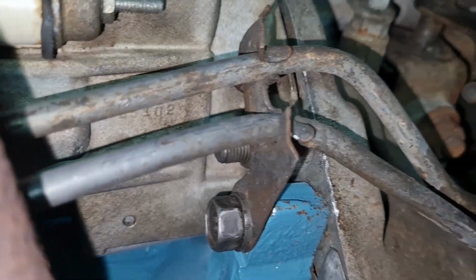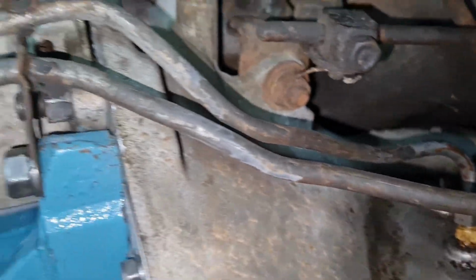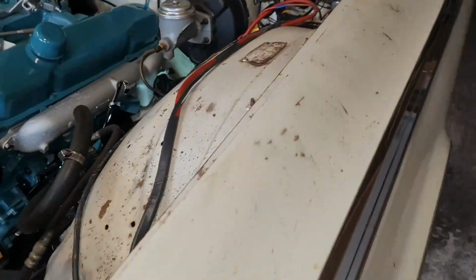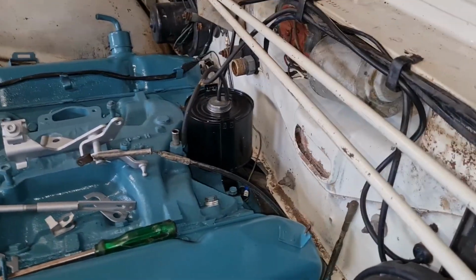You've got the little bracket on the transmission, the bottom transmission bolt there, that holds the bracket for your transmission cooler lines. That side's done as well. Like I say, they're up to 50 foot-pounds. They've got the exhaust gaskets in them. Excuse me as I roll out. So there you go. She's ready to go there. I can't remember if I said the vacuum canister is in. Don't know if I said that last night.